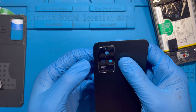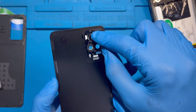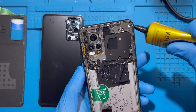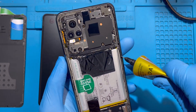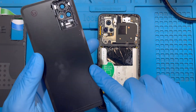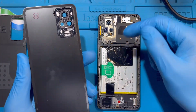After applying, put the camera cover inside very straight — don't tilt it. Make sure it is fixed well, and don't touch the inside with your finger so the camera lens doesn't get dirty. Then apply the glue all around the phone. The glue I'm applying is stronger than regular glue and will hold the phone very nicely.